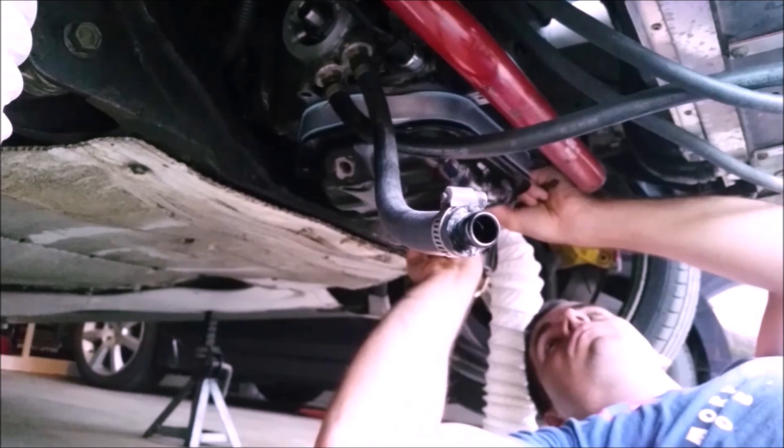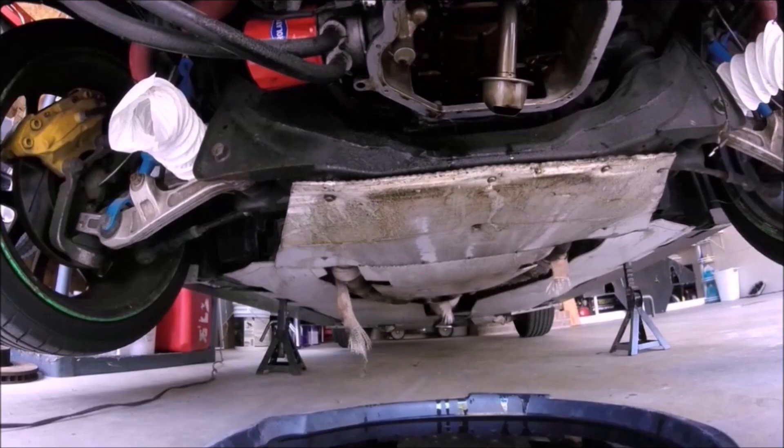You can see the sandwich plate bolted directly to the side of the engine. I got rid of that extra oil cooler and bolted it using the shorter HR stud versus the longer DE stud. I changed out the barbs to the smaller lines, and you can see the two oil cooler lines coming out, going under the core support, into a 90-degree barb fitting, and then going vertically up into the downward-facing barbs of the oil cooler.